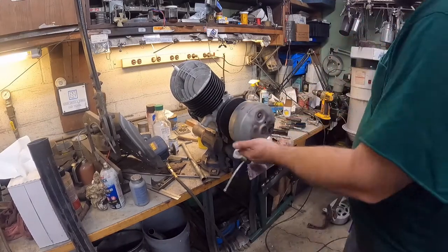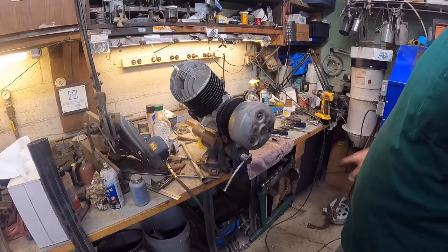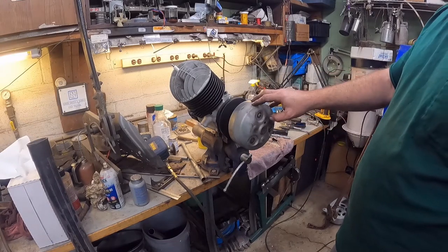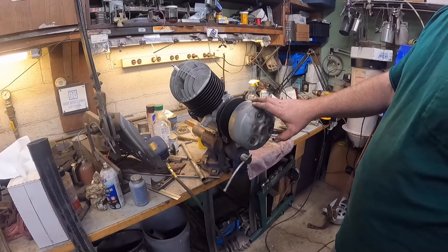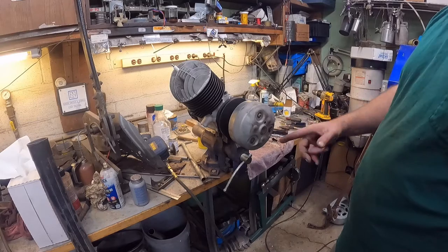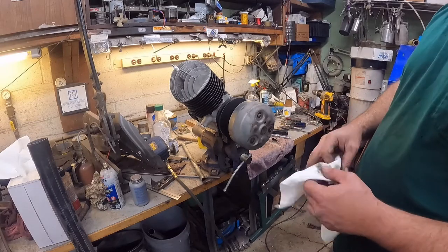And the reason why there's a fill plug there is this gets filled with transmission fluid. It calls for Harley Davidson transmission fluid. Probably regular transmission fluid would be just as fine. And it says 12 ounces, so it's not a whole lot in there, but enough.